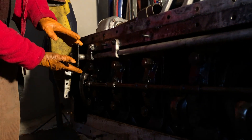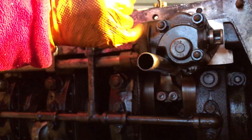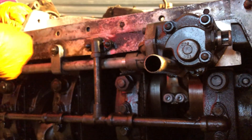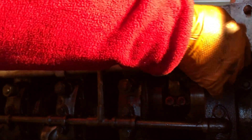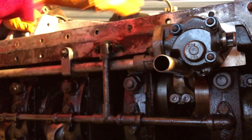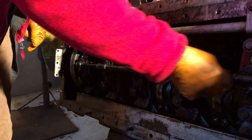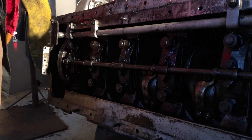Now the important thing is it has what's known as a scavenger — a small scavenger sump at the front here. And this pipe here sucks oil from that scavenger up into the oil pump and it just spills back into the sump then. This little device here simply stops that oil from the scavenger pipe spraying onto the end of the scroll bearing and encouraging oil to escape — it just deflects it down the way. So that's the conventional setup. This pipe here is for feeding the main journals on the crankshaft.